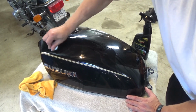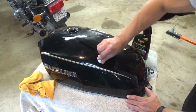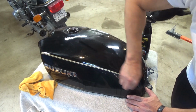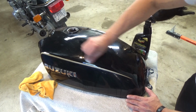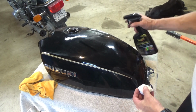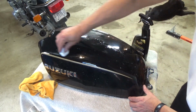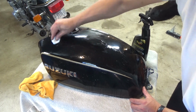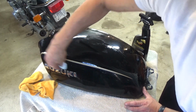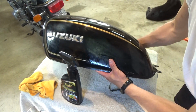So basically what this is, it's mildly abrasive. There's other compounds too, polishing compound. There's numerous products that will do something similar. But I've had good luck with the clay. With my white Sierra, on close inspection you'll see little rust fragments. Maybe I'll do a video on that. And essentially, that's oxidized pieces of metal that have sort of lodged on the surface of the paint, and then they corrode. So when you look at the paint, and actually I'm guessing most vehicles in the Northeast probably have this, it looks like little rust specks. And so a clay bar does a good job of cleaning that up. Kind of want to prop this up on the side so we can look at it here.